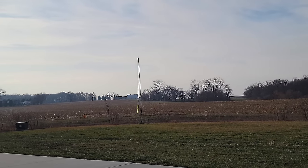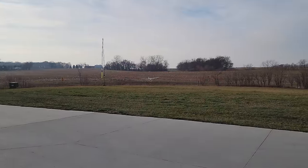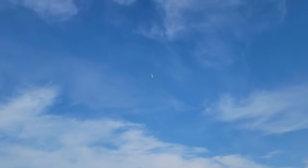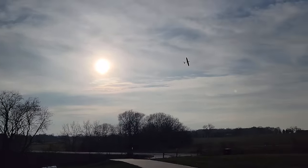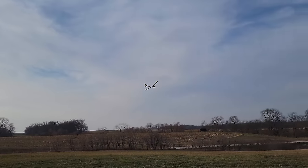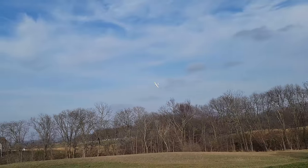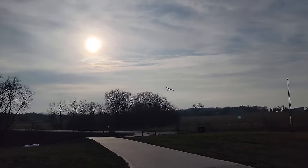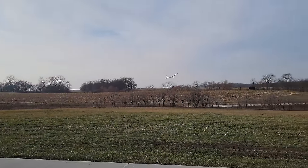Just cruising along right now. Boy, that looks sweet, doesn't it? Nice and calm. Or you can just go crazy, balls to the walls speed. This guy is so much better. We moved the control arms in on our ailerons one hole, on the elevator one hole, and the rudder all the way. The additional movement has been glorious and really makes for better flight performance.